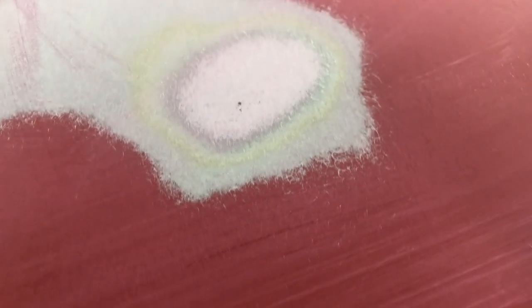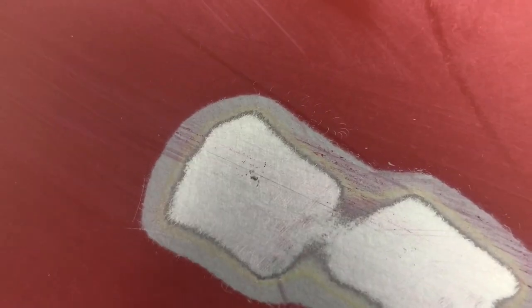I've just panelled the roof and I'm going to put a bit of rust treatment in a couple of places where I had to rub back to bare metal. You can see it best in this area here — just a little bit of pitting there. That's what I want to make sure is treated, because it's things like that I don't want to come back through. There's a little bit more over here — you couldn't even really see it through the paint, but I really don't want anything to come back. There's a tiny little bit over there as well.